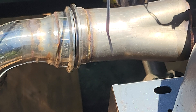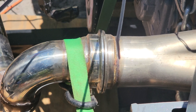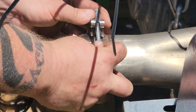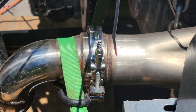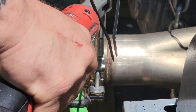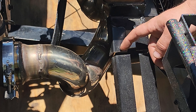On this other side you can kind of see how far off we are and what we need to do. I'm going to have to use this frame rail and a strap to pull it over a little bit. We've got our strap to bring it over, and now the v-band will cinch it all into place. Now that we got them both snugged up, we can go ahead and give them both beans.